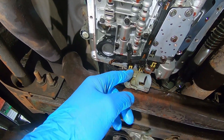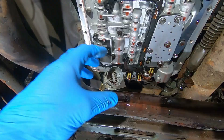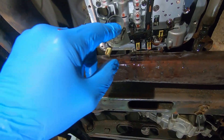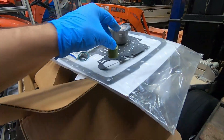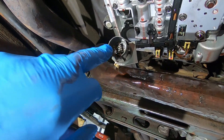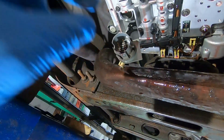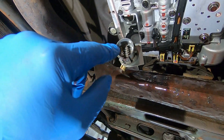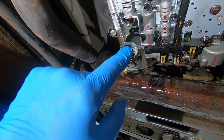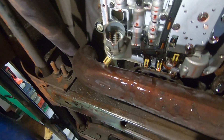When the connector drops, it leaks because that O-ring is no longer in place. The tabs and connector can also wear over time and allow a leak. There's also a tiny inner seal that fits inside the connector. The O-ring seals from the case to the connector, the inner seal seals from the connector to itself, and on the inside it seals from the seal to the electrical connector.